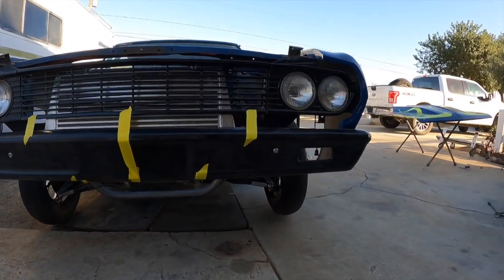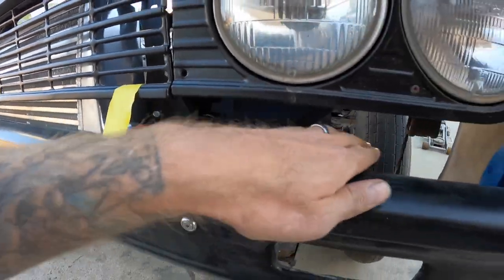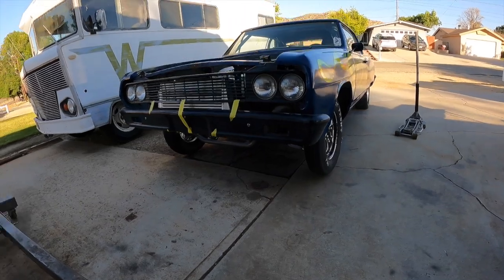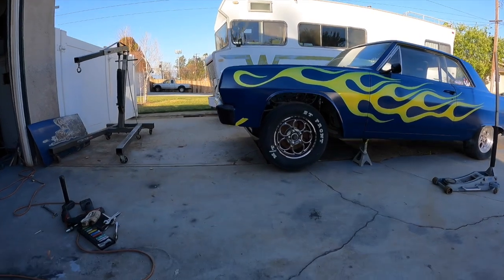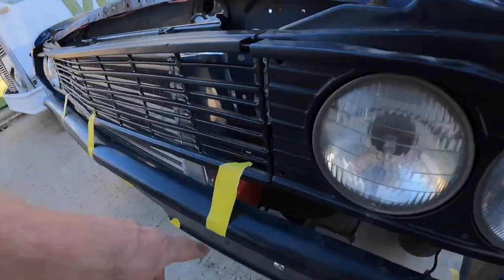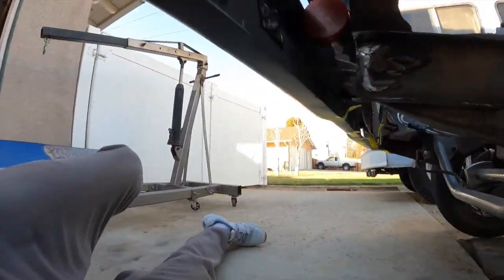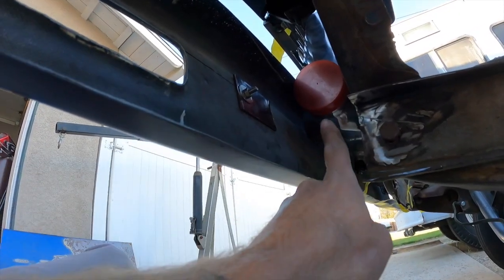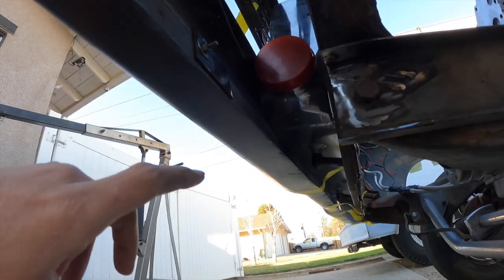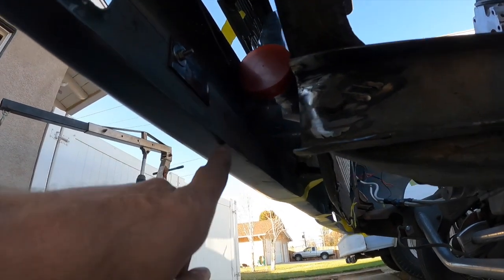I think that's about where it's gonna live. I'm happy with that. There's supposed to be a splash guard that goes in here but we're just gonna skip that. The plumbing — you'll see it a little bit, but maybe we can paint the plumbing black to kind of hide it. All in all, I think it looks good — better than the toothless bumper we had. It's pretty straight on the car. We'll finish it up and when I get it all mounted we can clearance everything so nothing's touching. Now we'll just get the distance from this portion to the pad up there, try to measure on both sides and keep it as straight as we can. This thing's super light — it's not gonna do damage to anything — but we'll try to clearance the thing. If we can stand it off a little bit, we'll be good to go.